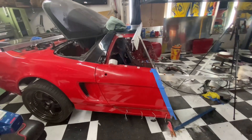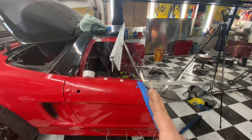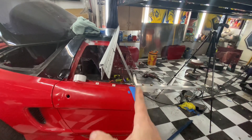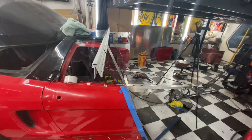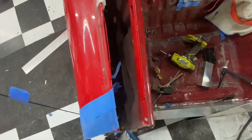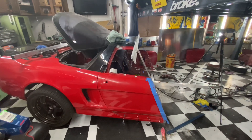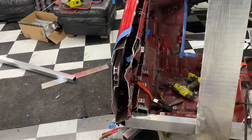It's a new day and I'm back out in the garage trying to figure out exactly where to cut these. It's nerve-wracking to cut completely straight and parallel with the other door so that when it shuts it's touching everything evenly at the same time. I had it marked here, but when I took a piece of metal and slid it across touching down there I ended up in a different spot — this does not look straight to me. Luckily I haven't cut all the way in; I left some extra room. I'm going to keep slicing off little bits until it's right. I'm cutting it for the second time now, leaving about a quarter inch of extra material instead of the two inches I had before, so I can fine-tune it.